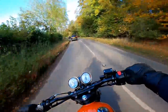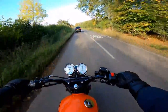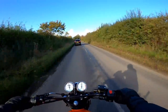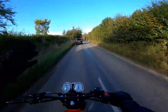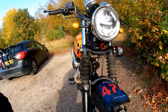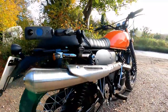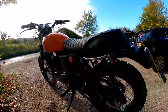In terms of handling, it's very stable actually for a lightweight 125. You have to make a definite grab with the handlebars to change its direction, so it's not all flighty and skittish. The ride itself seems all right. Suspension is very basic, as you'd suspect, but these are bumpy old roads and it's a comfortable ride. The suspension looks great — very retro looking with the gaiters. No adjustment, of course, and these are right-way-up forks. On the back, in keeping with its retro styling, it's got twin shocks, which look pretty cool and are absolutely adequate for a bike of this size, power, and weight.